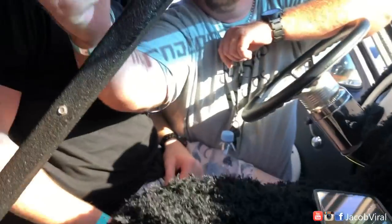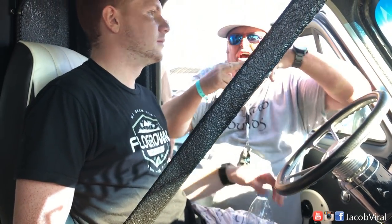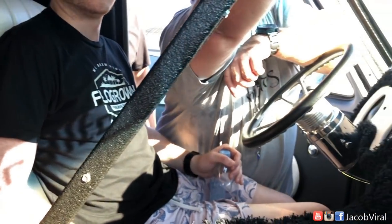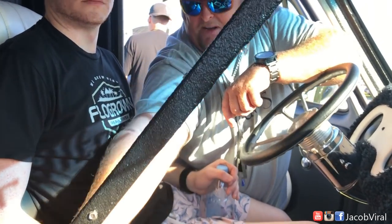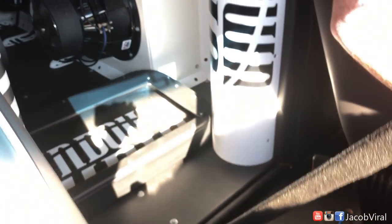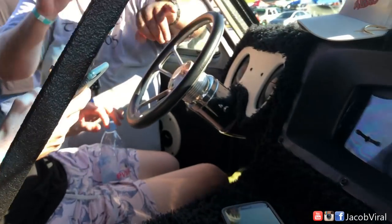Yep. Listen. This is not one bar, it's two bars that slide into each other. When I get done with Slamfest, I'm probably going to try to drill out some holes and silicone it and fill it and see if that helps. If it doesn't, I'm cutting it right there and down there. Then I'm going to put a 2-inch galvanized steel pipe with a threaded coupler in between, so you can literally go in there with a crescent wrench and tighten it down.